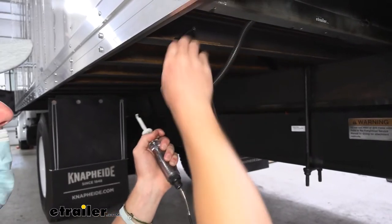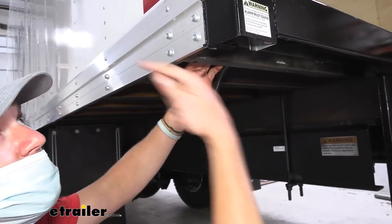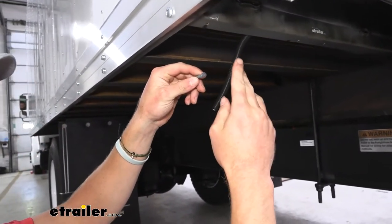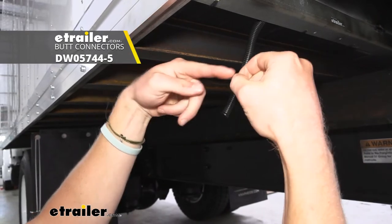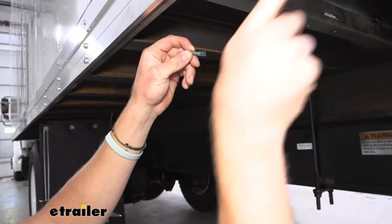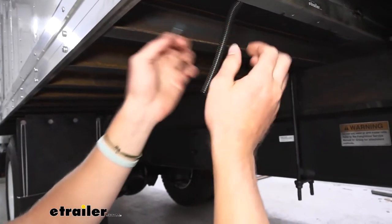We already ran this wire. Basically what you can do is take the wire that runs to your reverse light, cut it in half, take another wire and twist that together with one side, put it in the connector, clamp it down, and then take the other end to complete the circuit again. So you have two coming off this way — one goes to the alarm, the other goes to where it was before, and the third is just coming from the body harness.